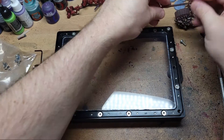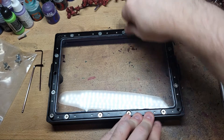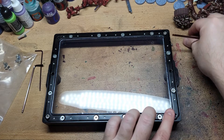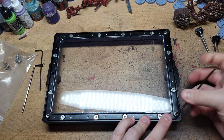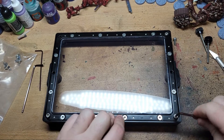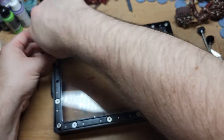Finally, the last four screws — the four corner screws on the Elegoo Saturn stick up a bit, so when you take it out of the machine and set it down it will actually sit on the screws rather than on the FEP sheet itself. This protects your sheet from random debris that might be on the table, which is quite nice. Getting those all screwed in, it should be almost ready to go.